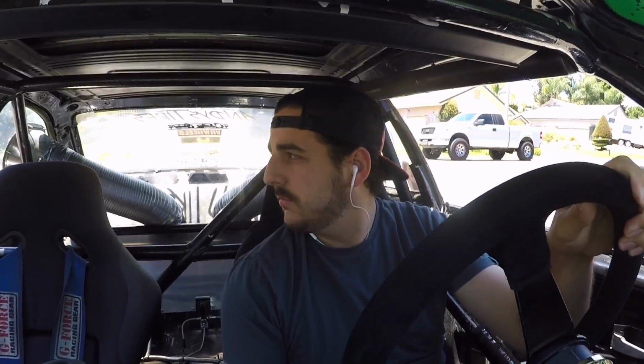Alright, so we do have a fat exhaust leak, which sucks. But I'll take you guys around the hood just to see how this thing works. If you don't want your dog box to clunk going into first gear, what you're going to want to do is push your clutch in and hold it in there for around 3 seconds and then put the transmission into gear. And it won't make any real loud noises, might make a little clunk, but that's about it. Versus clutch in, slam it into first gear, it hits the dogs really hard and it doesn't go well for them. So we'll do it right here. Ready? 1, 2, 3. Little clunk, nothing major.